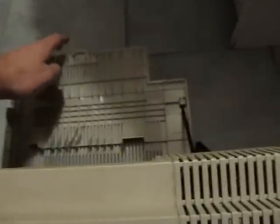I managed to successfully print a page by opening the rear hatch while it was in the middle of printing, so it just came out the back and it had no problems whatsoever. And if I remember right, when it jams, it passes through this roller successfully. So the problem is in the very last roller, this one right here. So, hey, at least it's nothing deep inside the printer. This roller ought to be one of the easier ones to replace. Maybe, I'm just assuming.